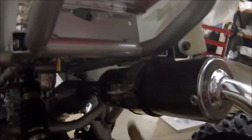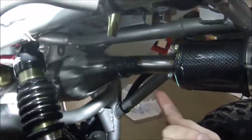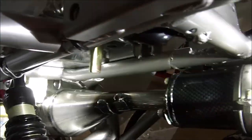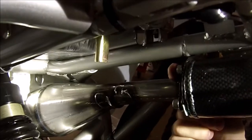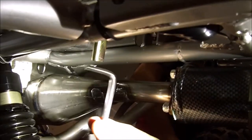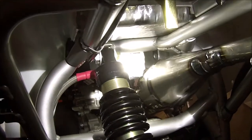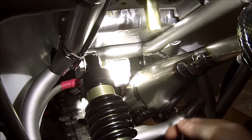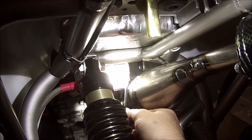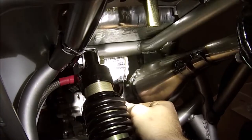Once you have all the bolts connected here, you have the rubber. This is a 12, that's a 14. The Allens here — you can use a little gun like this to put them on. It'll be a little easier for the two bottom ones. The top one you're going to need to use an Allen to get that all tight. First you have the gasket, and then you have the screen, and then you're going to use an Allen for the top and just tighten it up. When you're doing this, make sure the pipe hasn't twisted because it's held on by two springs up front. Make sure there's an air gap between the battery box and the pipe. If there isn't, you can simply twist it because it's held on by two springs on the head pipe. If you don't, it's going to melt the battery box. So make sure there's air gap in there.